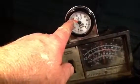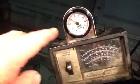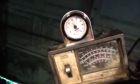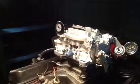Okay, now I want him to get up in here with the camera. You see right here — we're sitting at 12 parts, the red light's out. You're seeing the red reflections in that light on my hand. Anyway, we're going to accelerate and watch this mixture get thinner. Every carburetor running properly — the more you accelerate it, the thinner the mixture will get, because you don't need as much liquid to propel it. As you go down, your inertia is overcome and your mixture will get thinner and thinner. You don't need to have a rich mixture.